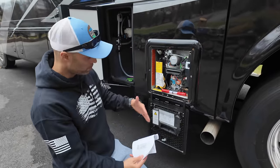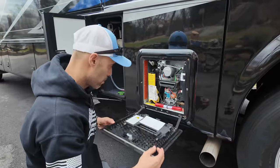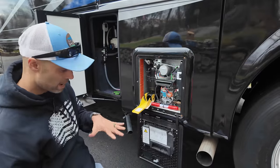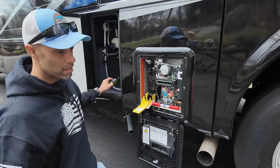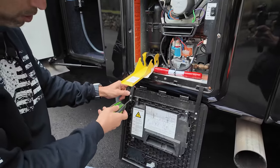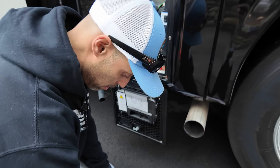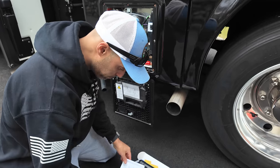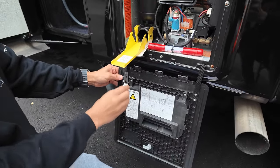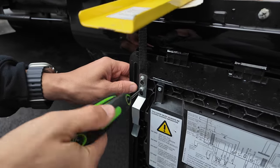According to the instructions, first thing you do is open up the unit — super simple. To open the Truma, you just unlock it, bring it down, and that's it. You're then going to open up the latch where your old filter would be and take it out. Next, you're going to need an Allen key. You're going to loosen these two little bolts right here where the fabric is — loosen one, then number two. What you're going to install here is the holder. The way it's shown to be installed is very simple: put these on, loosen the second one up a bit more, put them in and down, then tighten up the bolts. Then we go to step number two.